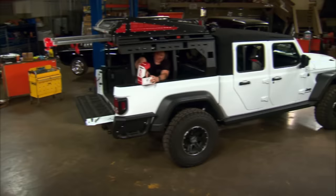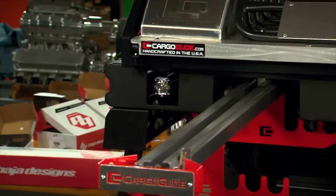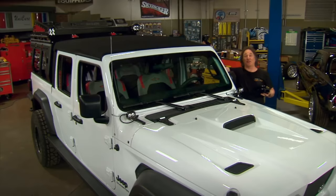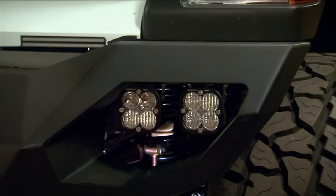Next are some serious spotlights — we're going to use LP4s, a four-bulb spotlight that will throw light way down the trail. You want to get these things up off the ground so the light can really go out there. The rack seemed like a good idea, but this rack retracts to the back so all this top area moves. If we come down to the side, it still gives us the height we need, we can adjust the light to aim in different directions, and it'll clear the top when we open it. Since this is a search and rescue vehicle, it's important to have work areas around the vehicle, so we'll add work lights in the pocket to throw light out to a work area, plus wide turning lights to throw light back for when we're backing up at night. In the very back on the rack, we'll run small spotlights to throw light back down the trail when backing up, and big LP6 spotlights in the center of the rack to throw even more light down the trail.